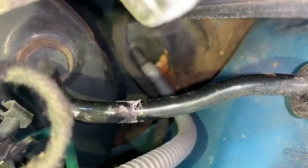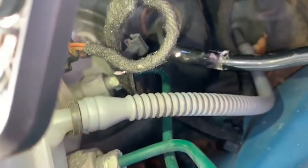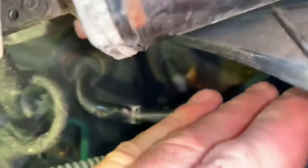I'm pointing right at the back of the master cylinder. We've got two pipes going in - there's a grey one here that connects straight in at the top. You can disconnect the grey one just by pulling it out - it's safe because it's the return pipe, you might get a bit of excess fluid but don't worry about that. Underneath the grey pipe there's another pipe that comes through further down - that one goes horizontally through this bit of metal and into the back of the master cylinder just below the grey pipe. That one has a circlip on it, so you need to get a flat screwdriver in there and pop it off. You can get your hand in to work, but I can't film at the same time without taking all this off, which is unnecessary and creates a lot more work.